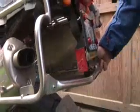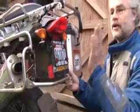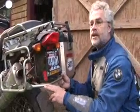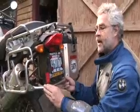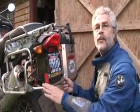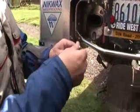Last summer, in 2006, I was in the middle of Siberia, and I met this Russian on the same bike. I couldn't believe it. A guy living way out in eastern Siberia had been in Moscow, bought this bike. One problem he had, he lost this bar here. That taught me immediately that that's a weak point. What did I do? I got some blue Loctite 242.